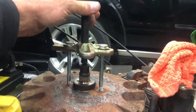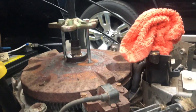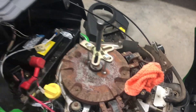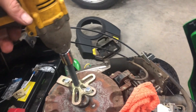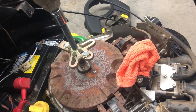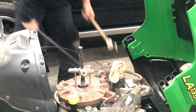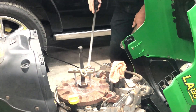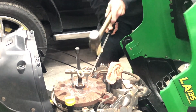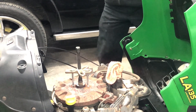Make sure it's even. Tighten up the big bolt — mine takes a 19-millimeter socket. Give it a little bit of torque. Then use a hammer and pry bar, go underneath, and lift up on it a little bit. There you go — she's off.